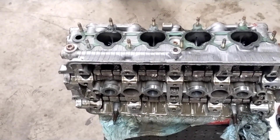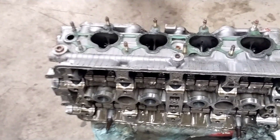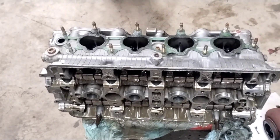I remembered I bent the valves with the built head, so I actually had Pro1 cams in a stock head — which everyone says is not recommended because the factory spring pressure isn't meant for Skunk2 Pro1 camshafts. But I drove all winter, a whole year on this motor with that setup and did not have one issue. Do I recommend it? No. Do I recommend spraying a 12.5 to 13 to 1 compression motor on nitrous in the winter? Absolutely not.